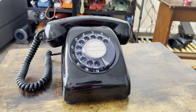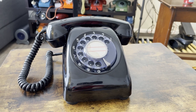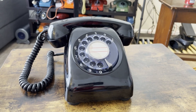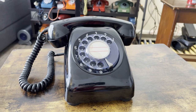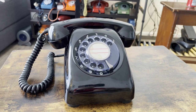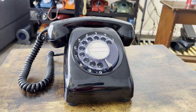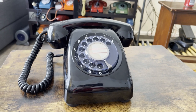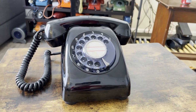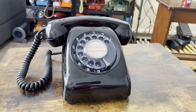The Model 600 was the first telephone to only use printed circuit boards for its wiring, doing away with the traditional wiring of the Type 4 telephone. With the exception of the dial attached to the housing, everything on the base — including the ringer and the printed circuit board — is riveted in. All components of the rotary dial are also riveted, just like the number 9 dial found on Western Electric 500s, so you can never take the gears apart.